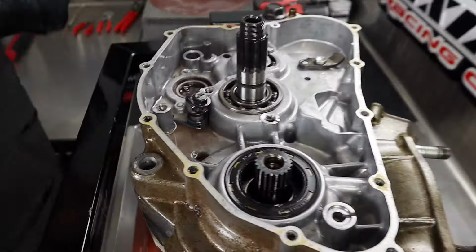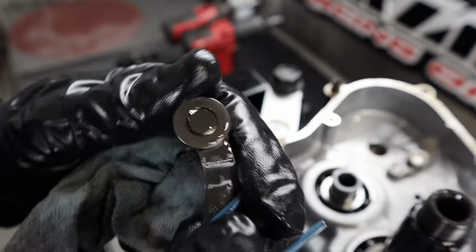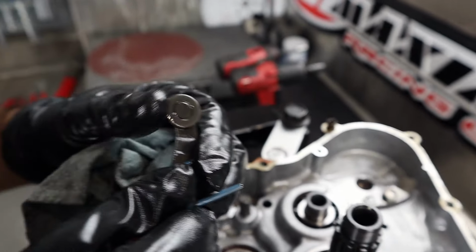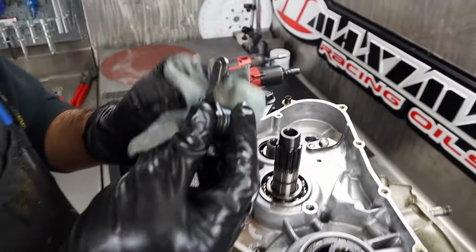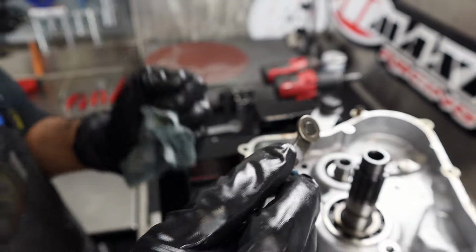So these pizza cutters on these Hondas, did they always use a solid roller on the end of that thing? As I can remember. Unlike the YZ250, which had a caged bearing type that would explode and go through the transmission, while the YZ125 had a solid roller at the same time, which doesn't really make any sense. I don't know why they did that. And then they went back to the solid after '15 or something like that, wasn't it? I heard that, later years.